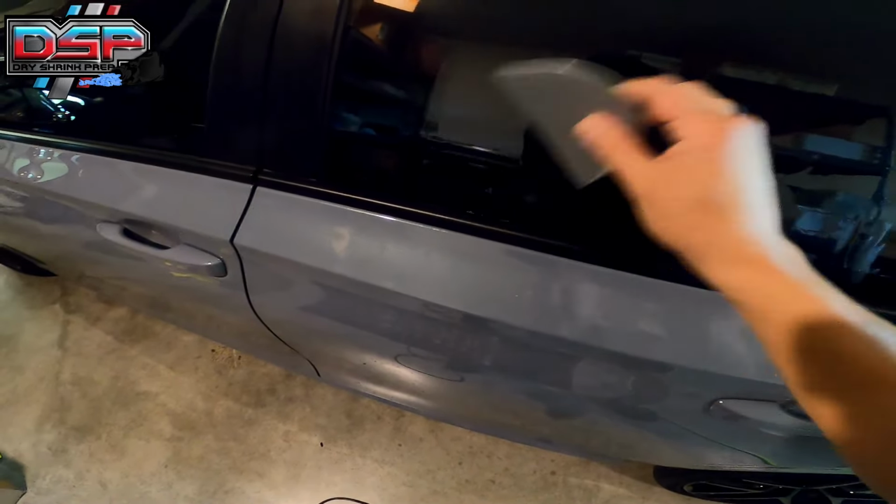It's not too bad for side windows, but if you're doing those hard lines on the back window when you're dry shrinking, it's going to be really hard to card it, and you're essentially over shrinking it, and then it could potentially be harder for you to install. So the trick of this is to be able to install these windows the easiest way possible for you.